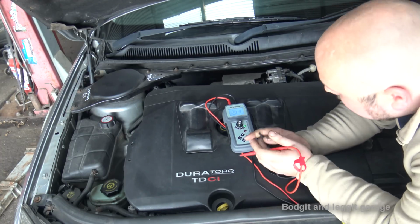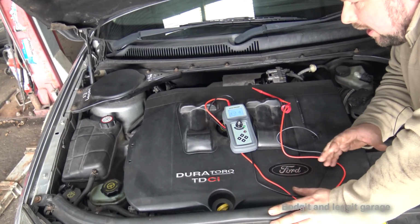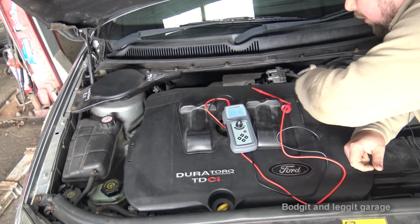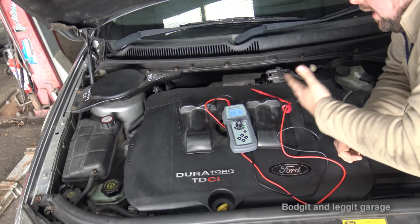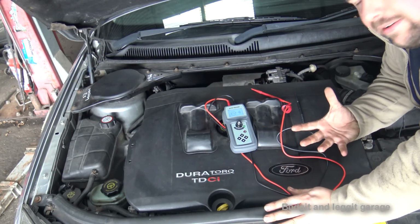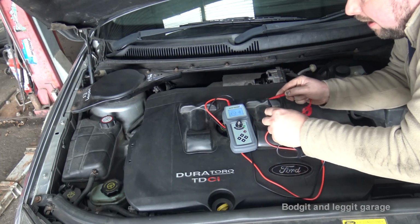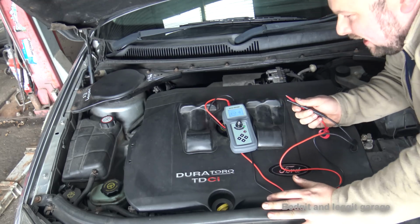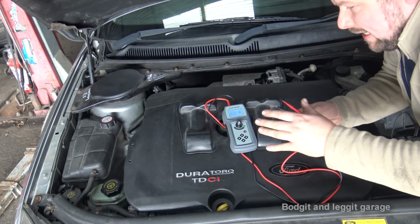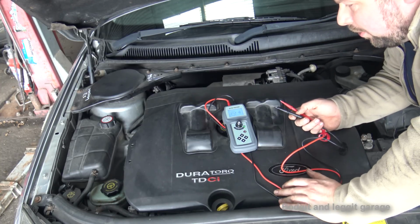Yeah. Now, with the continuity tester, you do have to be careful. It can kind of get you stuck sometimes if you're trying to test a wire. For example, let's say you have a wire running across and you can see both ends, but you can't see the middle of it, and you want to see if that wire is okay. By putting these two connections on either end, if it bleeps, you might think, oh, well, that's okay. Not necessarily, because you could have a couple of strands of wire that connected, but if you do other tests on it, you'll realize you have problems.